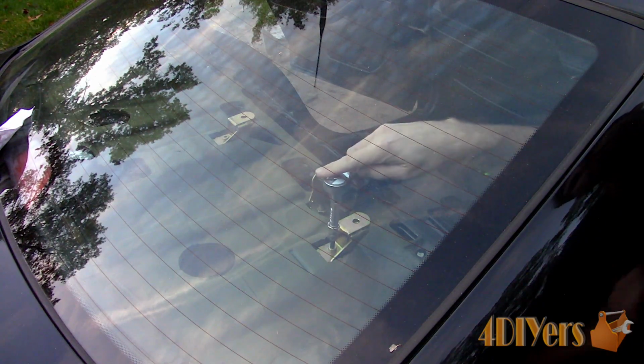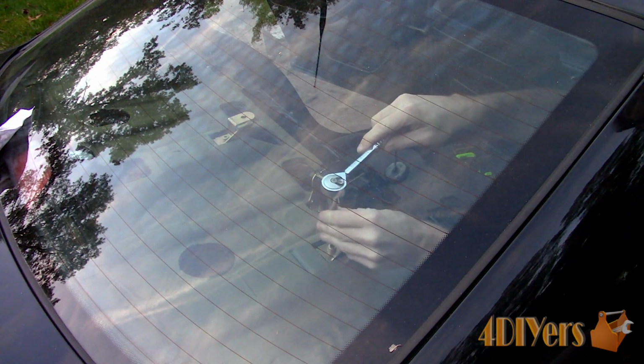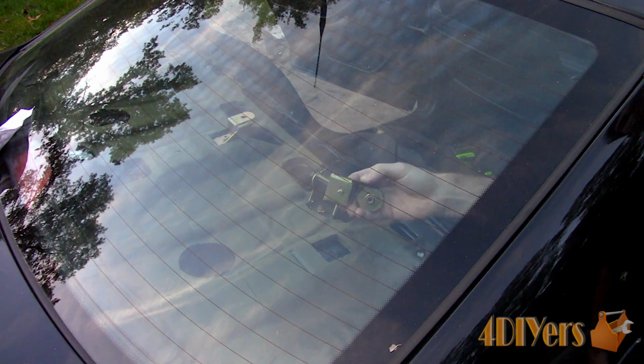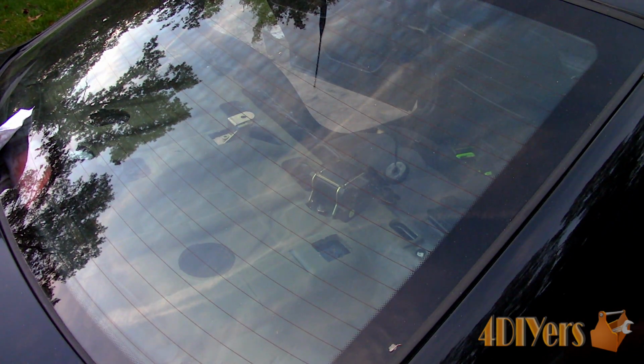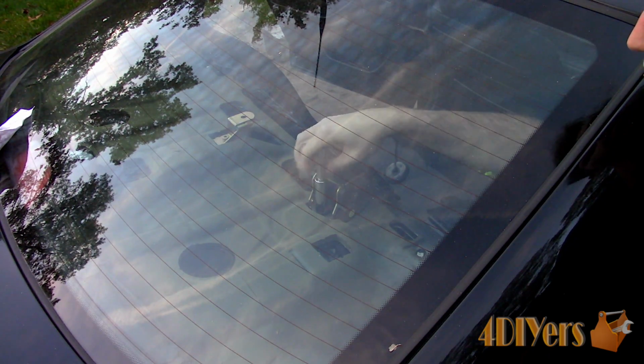For the 3 child restraint brackets, these are held in with T40 Torx bolts. Once that bolt has been removed, the brackets can be taken out. The seat belt reels will also need to be removed in order to move the sound insulation. These use a 16mm nut and lift out once the nut has been removed. There will be 3 in total.